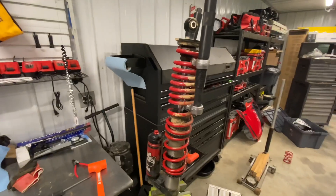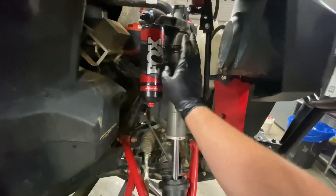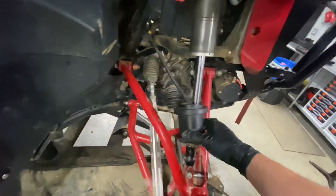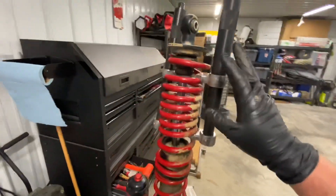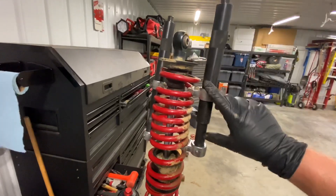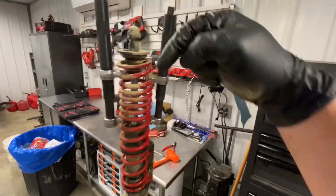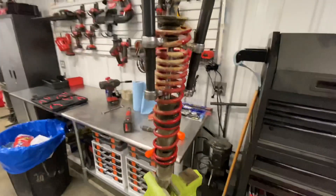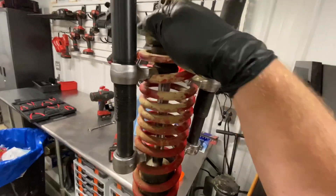You just saw the removal of one of the front shocks. I'm not going to go into the entire process of removing it, but I've already got this one taken care of. I broke my crossover rings loose as well as my locking nuts loose and put it back in there until my springs come in the mail. Question one I'm sure is going to be asked is: what are these spring compressors, and where did I get them? The answer is they are Shankly. I got them on Amazon — the link will be in the description. Once you get this compressed, it takes the tension off of the spring perch.